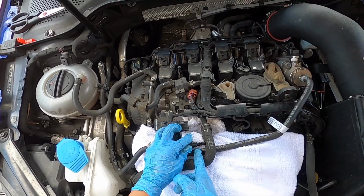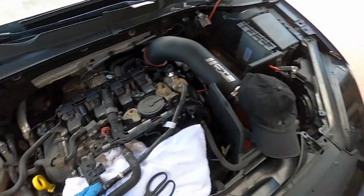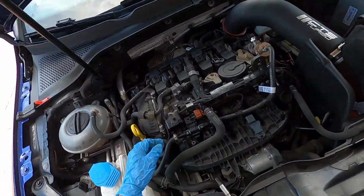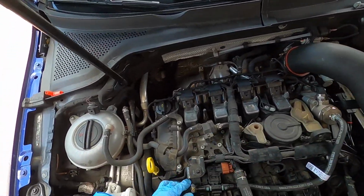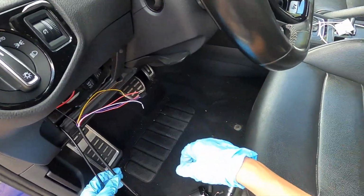So the hose will go, I'll cut to right here. Now I'll take our hose clamp, slip it over, and now I'm going to tighten this down. There we go, guys. So that's on there pretty solidly. I'm just going to go around and tighten down the hose clamps one more time. So the sensor is wired up right here, connects into the fuel line. Quick disconnects are on solidly. Fuel line is good. So the only thing left is getting this wired on right now.